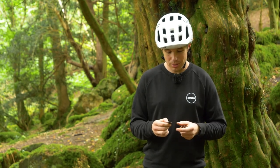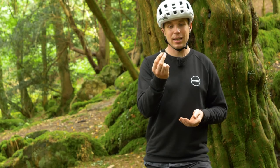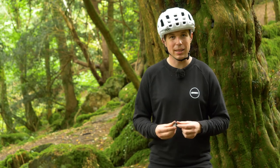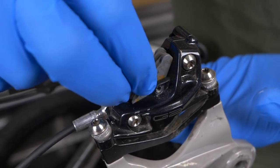If you're out on a ride and you notice your brake pads are getting a little low, then this is something you can do. What you want to do is remove this spring. This spring is there to ensure your pads don't vibrate within the caliper. With this removed it's going to be a lot louder, but it stops the spring itself fouling on the rotor when you apply your brakes and will enable you to eke out precious more material from your pads.